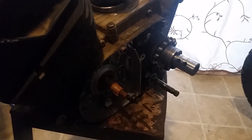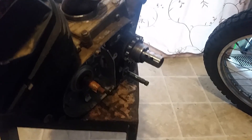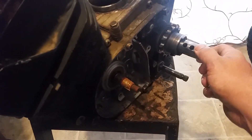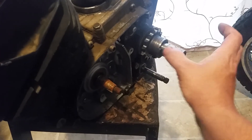You might notice that big shaft right there. On the side cover — which I don't have with me, it's in my shed buried under totes — there's a box that goes on the side. It looks like a bubble on the side cover, and that has the high and low range. The gearbox inside is the same one as your KE100, KD80, KM100 — except the shaft is elongated so it comes all the way through, the gear slides on the shaft, and the ratio is changed in that box from high to low.